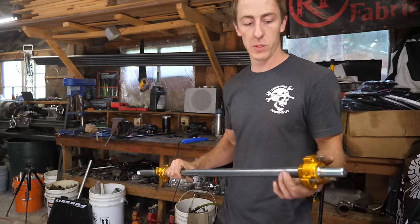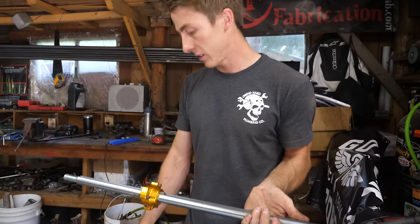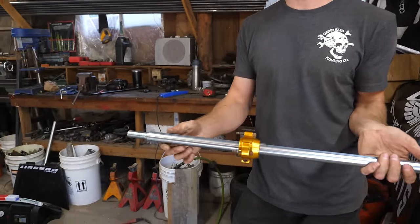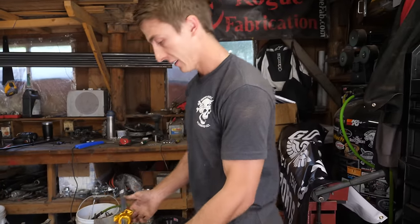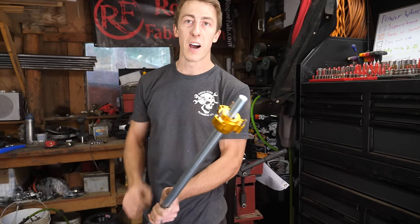The next thing we did is we mounted the hubs onto the axle. We were trying to make it look good aesthetically with the body so they weren't too far out or too narrow, but we were also trying to save a chunk of this shaft to make the jackshaft out of — and it looks like it's going to work. So once I got that set up I'm just going to mark this, cut that section off, and then cut the threads off because that's not for us.